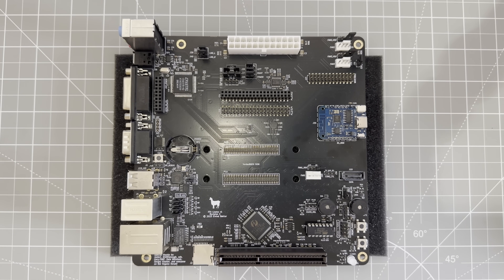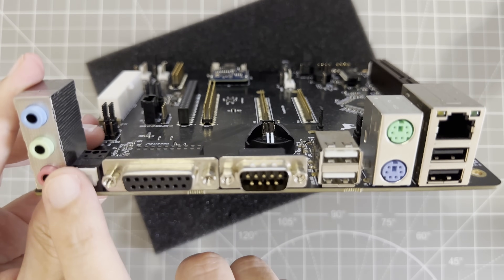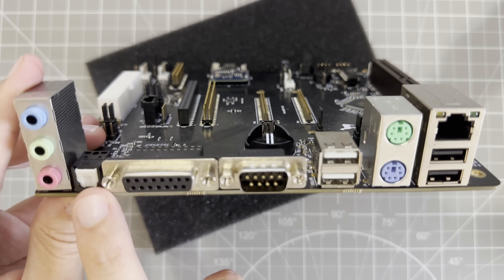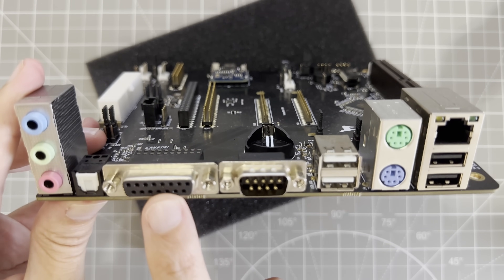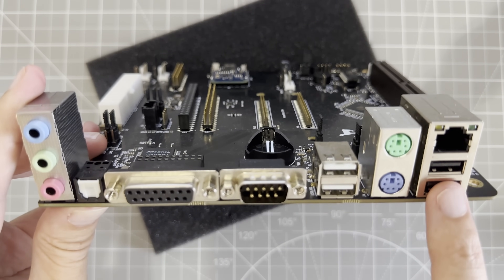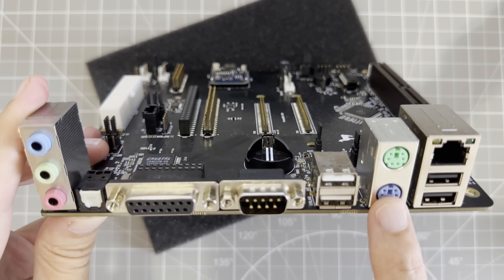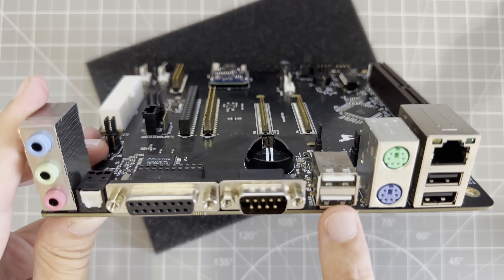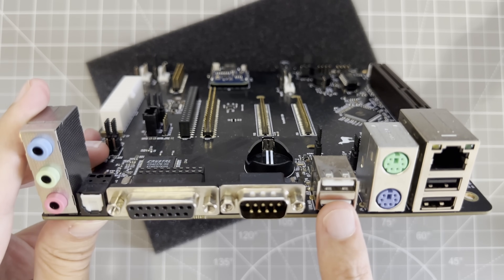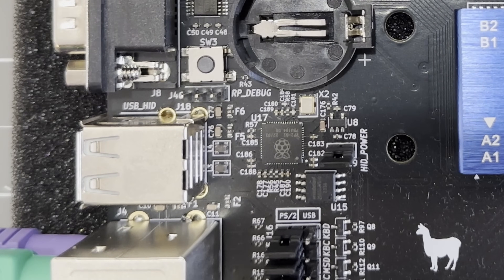The microSD card is mounted as a hard disk, and there's even a hard disk clicker to mimic the sound of an old spinning drive. Taking a quick tour of other features: we have analog line in, line out and microphone, Toslink digital audio, a game port, a serial port, an ethernet port, and two USB 2.0 ports. For keyboard and mouse, we can connect a PS2 keyboard and mouse, or a modern USB keyboard and mouse — those special ports use an RP2040 chip to convert USB protocol to PS2.